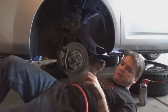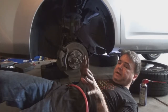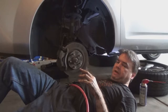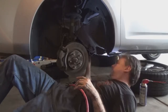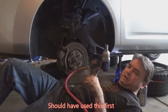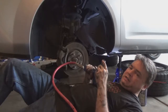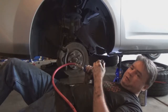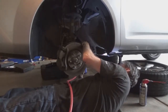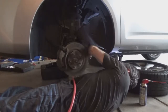Okay, I'm starting on the driver's side control arm, and knowing the problem I had getting the other side broken free, I've got a box end wrench on the castle nut up here, and I've got my impact wrench, my air gun, set up with an 18 millimeter socket, and I'm using this to break it free and see if I can do that. So that actually worked really well. I already did it, and it worked exceptionally well.